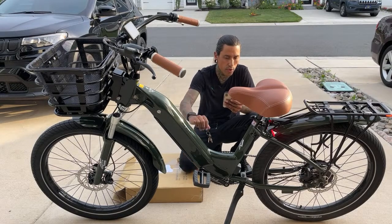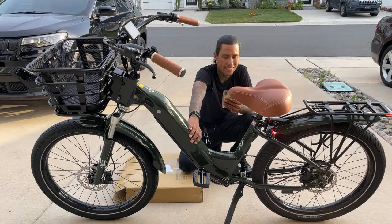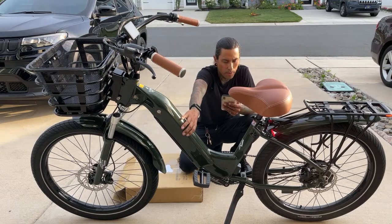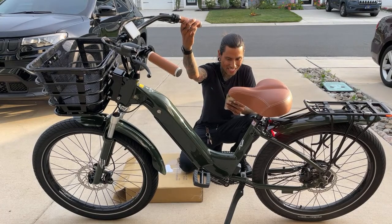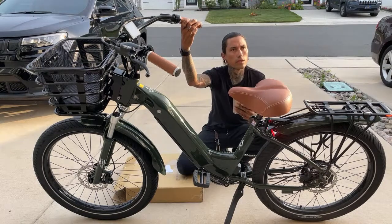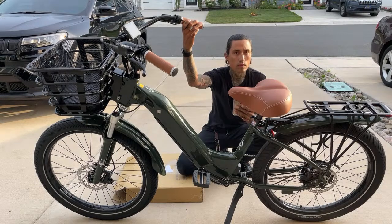The brakes are Tektro E530 hydraulic brakes with safety electrical motor disconnect wiring. So I'm guessing that's brake cutoff sensors. Brake levers, aluminum alloy, comfort grip levers with motor cutoff switch. That's a motor cutoff switch. I don't know what that safety electrical motor disconnect wiring is. I haven't heard that. Anti-spark. Like some of the Surron plugs have anti-spark. So if you plug it in, there's still voltage, or unplug it. Oh, it prevents the plug from shorting. Gotcha.